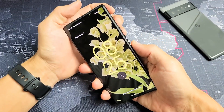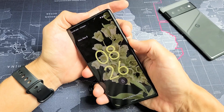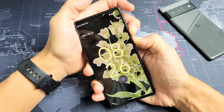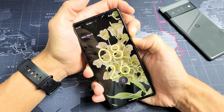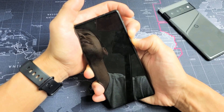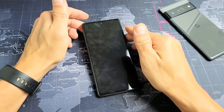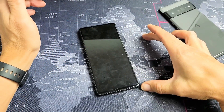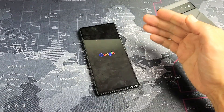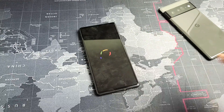If you're still stuck in a boot loop, no problem. Remember: power button, volume up for 20 seconds. Press and hold both buttons for 20 seconds, then let go. The phone just turned off; now it's going to boot back up and we'll see the Google logo. Hopefully it boots up properly. If you're still stuck in a boot loop, we're going to go to the next possible solution.